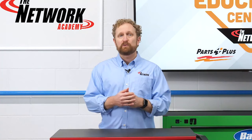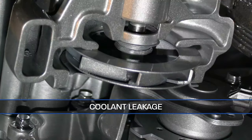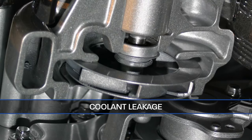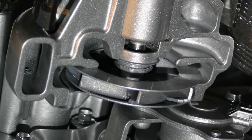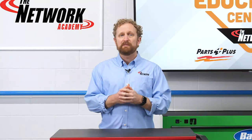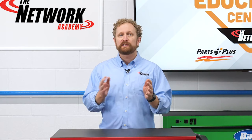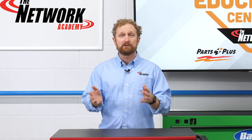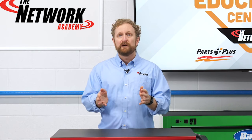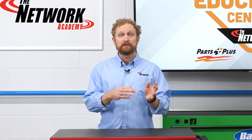Another classic sign of a failing water pump is coolant leakage. The unitized seal assembly inside the water pump that surrounds and supports the shaft typically uses a hard ceramic seal to prevent coolant seepage around the shaft. Any abrasive contaminants that circulate with the coolant will scour the seal and eventually cause it to fail. The first sign of seal wear or impending seal failure is coolant leaking out the small vent hole on the pump housing or coolant leaking around the shaft.